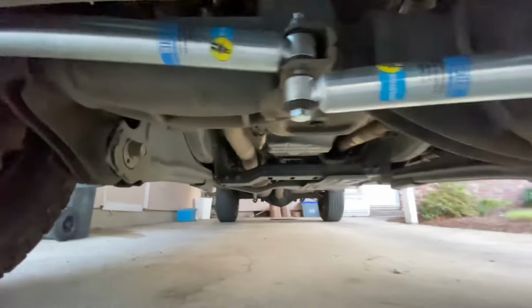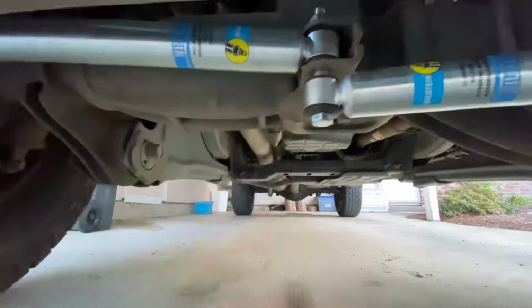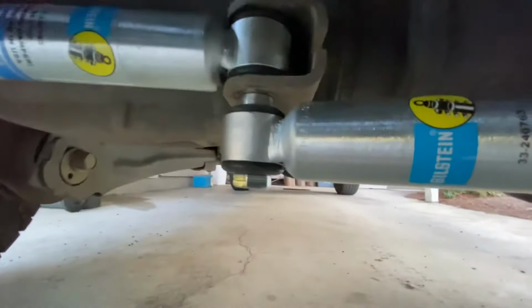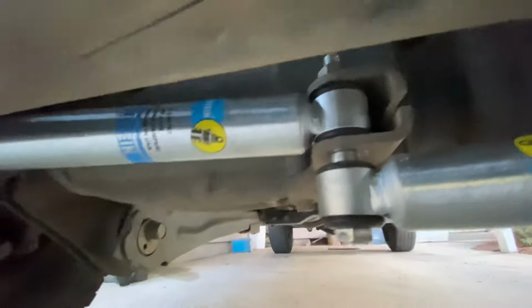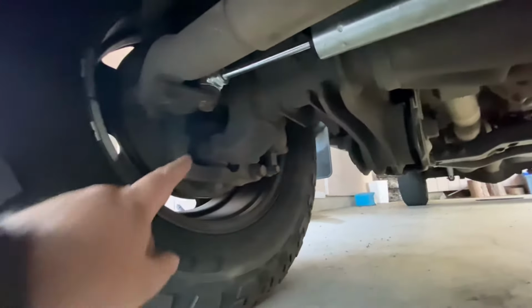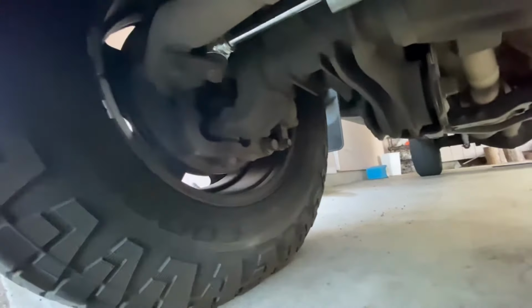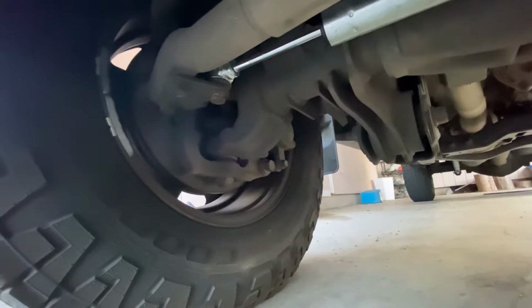You've got to mount a bracket that is measured 491 millimeters from this point here to the end hole here. This bracket's held on with some Allen keys. Slip the bolt through. There's a spacer right there. And tighten everything down. You actually save the original bolt from this end here and reuse it with the lock nut up top.